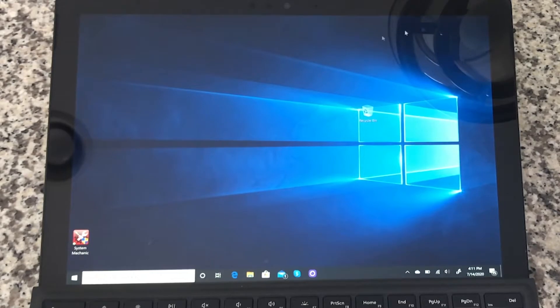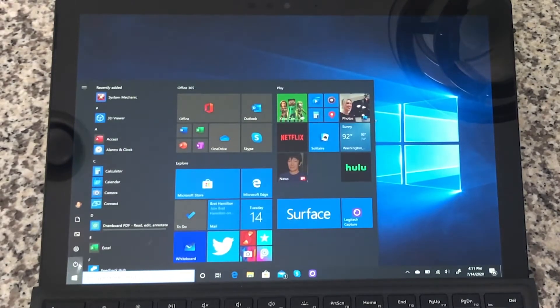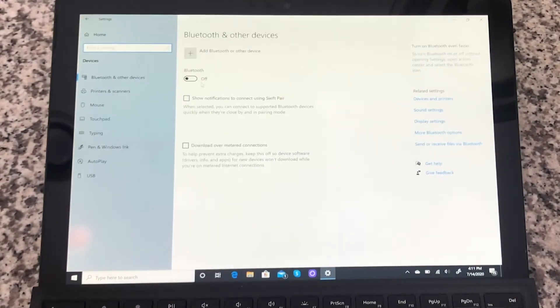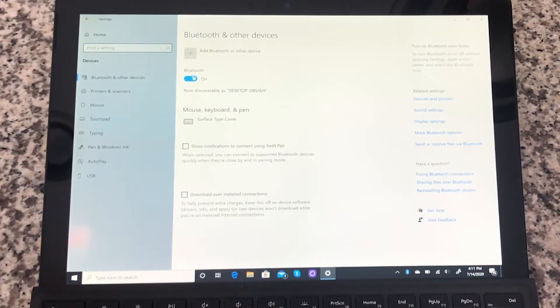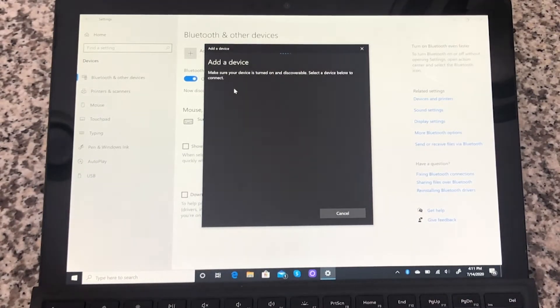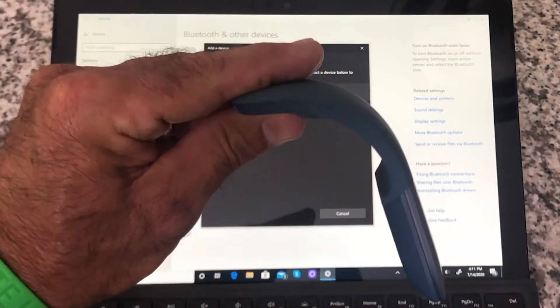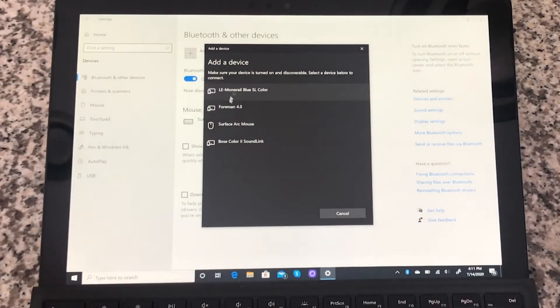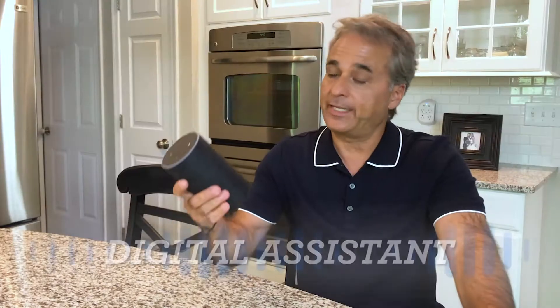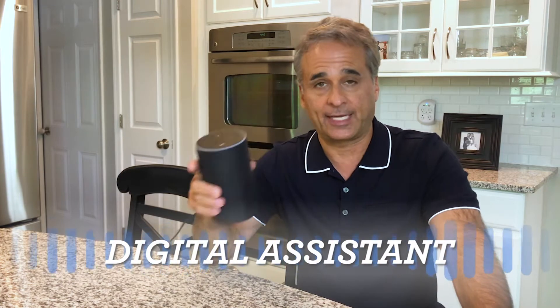From a wireless keyboard you can use with a tablet, to a wireless mouse that connects to your computer — check this out. To connect a wireless mouse to a Windows 10 computer, go to the lower left-hand corner and open up your settings. Once inside settings, you'll see an option for devices. Inside devices, turn on Bluetooth, then click to add a Bluetooth device. We're going to add a mouse — opening it up in a literal sense — which enables the Bluetooth arc mouse to be discoverable. Double-click onto it and wait for it to connect. Your device is ready to go.